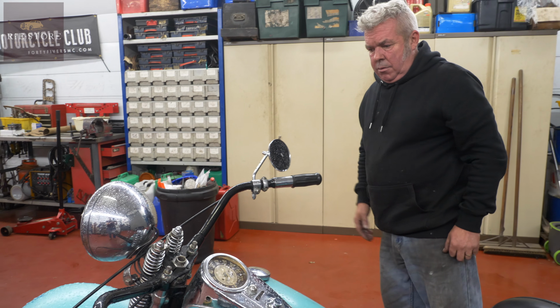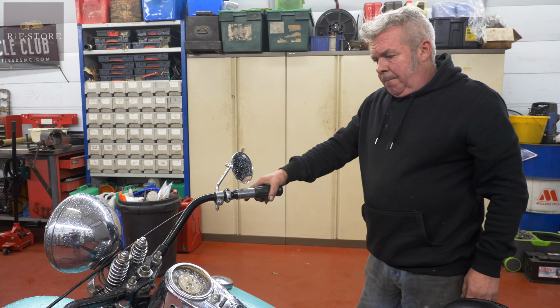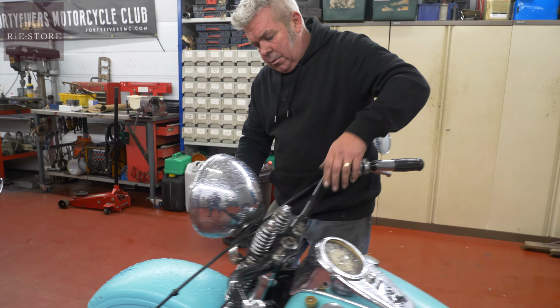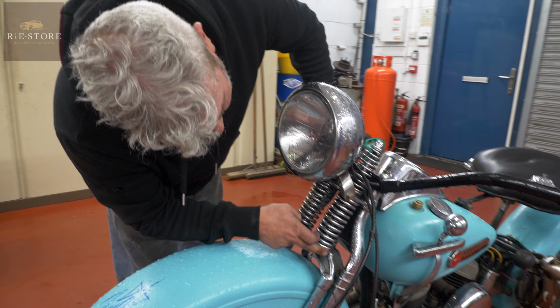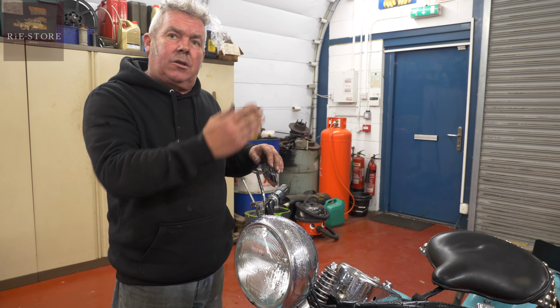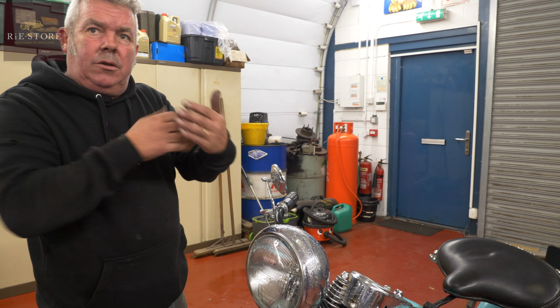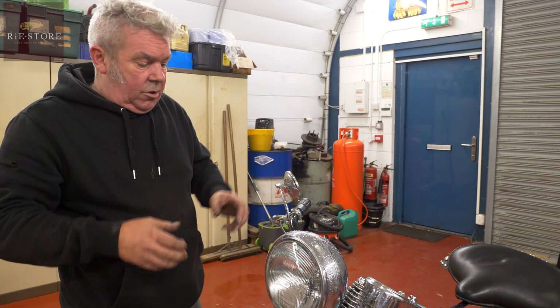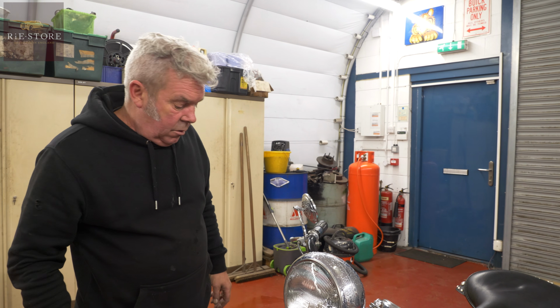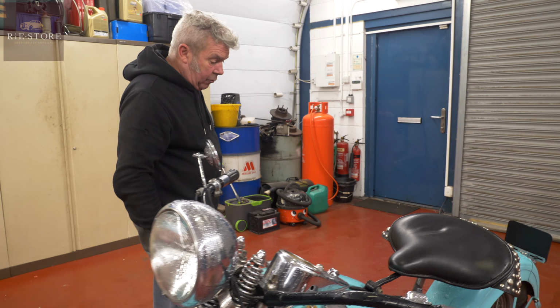You mentioned there's no ride control on there either? No, you can have ride control on the side, which goes from that bolt there up to that bolt there. You just have a knob on the side. All it is a sliding plate either side with fibre washers that you can tighten up. Yeah. And that just gives you bounce if you've got bouncy springs, you know. You can do the ride control, just nip it up on those.